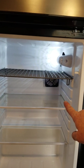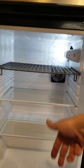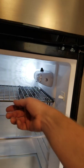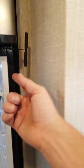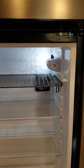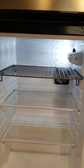There are power wires in the back of the fridge and I just tapped into those — they're literally screw-on connectors, you just put the wires right in, super easy. I ran them up behind the fridge on the side, pulled the little screw out, pulled the panel off, drilled a small hole through the insulation, ran the wires through, and powered the fan with the switch. Bada bing, super easy. I'm getting another wire shelf to replace the other glass shelf too. Okay, see you guys later.